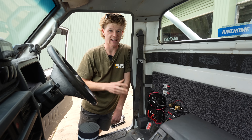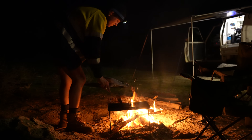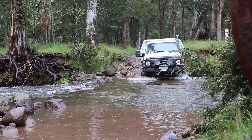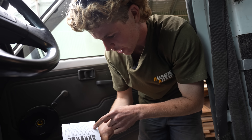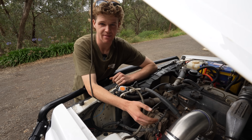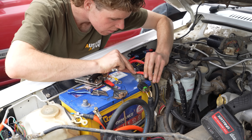Theoretically, this system is capable of charging my secondary battery at 140 amps — you might think that's overkill for a 100 amp hour battery, but it's exactly why I wanted this system. For the style of camping I do — generally only two or three nights at most — I didn't need that extra 200 amp hours of battery with all the extra weight, room, and cost, when I can drive to the next campsite for only an hour and charge my battery back to 100%. However, to use this system to its full potential, you've got to make sure the rest of the car's 12 volt is up to scratch. When we first got it wired up, we could only get 20 amps through to the second battery. After some testing, we quickly realised we were being limited by the vehicle's factory wiring — the alternator is only rated at up to 70 amps, and the cable coming off it to the starter battery was way undersized. As soon as we ran a new alternator cable to the battery, we instantly saw an improvement in charging capacity.